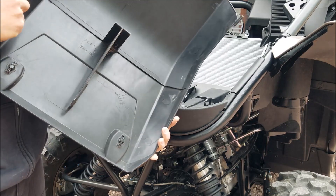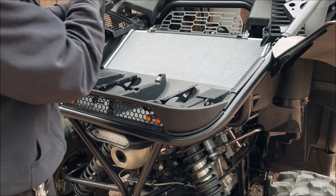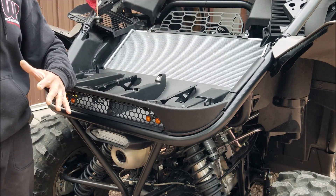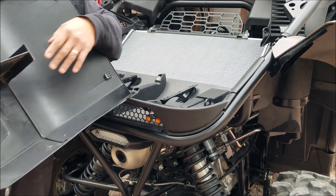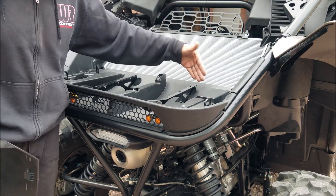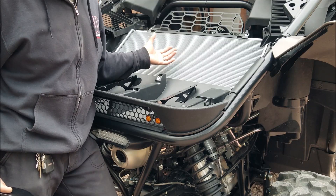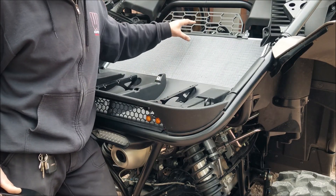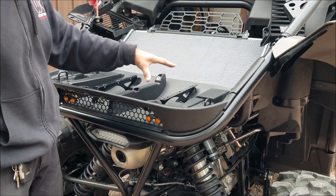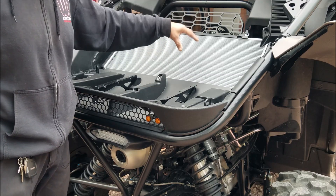What some guys don't realize is that with this divider that I've cut out, you're only getting half the heat — the other half is blowing out the back. When you remove this divider, all your heat will go that way, with one caveat: that could block off this channel. I'm getting 30 degrees cooler temperatures with this configuration. In the summertime, the only thing I have to do is leave my shroud off and it'll blow the air upwards. There are ways around the aesthetics that I'll go over.